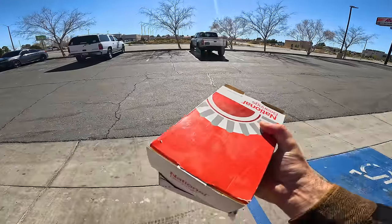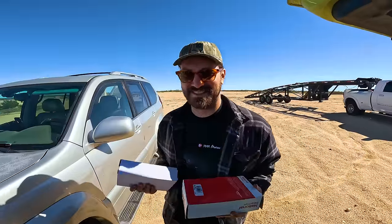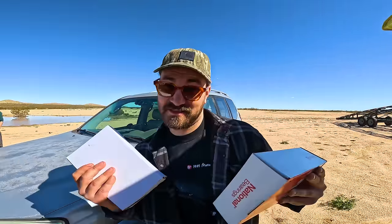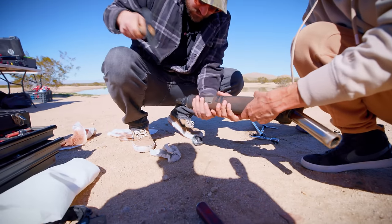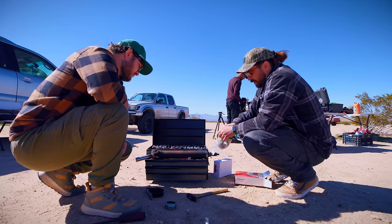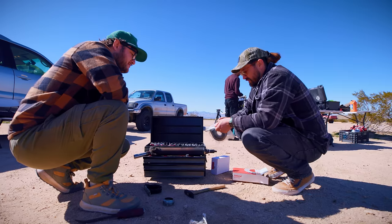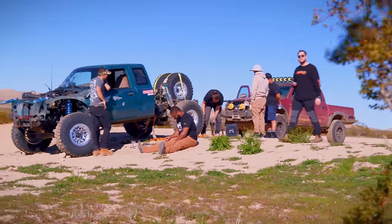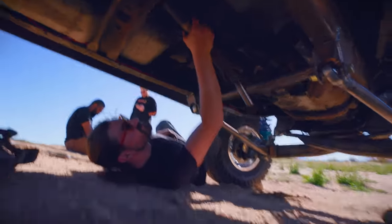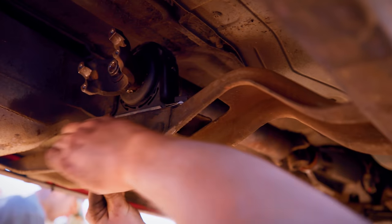Got two of them, not sure which one we need. One of them was a lot more expensive than the other. Stupendous. Yes. One should work. Yep. For now, neither one of these is long for this world, I think. So this drive shaft is a stock drive shaft, and obviously our rear axle differential, all that is not stock, and we've got a lot more travel, so we need a longer drive shaft. But we really only need the stock drive shaft to get us through today. We just want to get through this testing. So while I do think that even a new support bearing is not gonna solve our problems, it will hopefully get us through today. That's all I want.